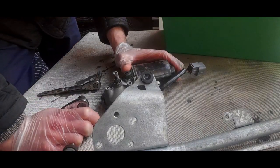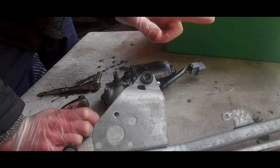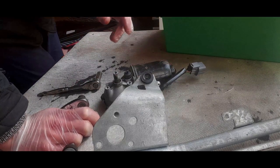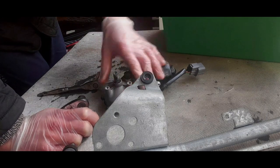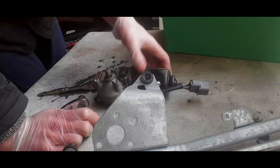But some people did not want it at all. And it's possible my car was never configured with super locking. The only way you'll know is go to one of these places that have these machines that can plug in and read the Pektron unit. There's a few places.